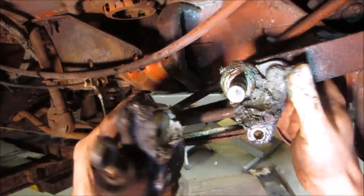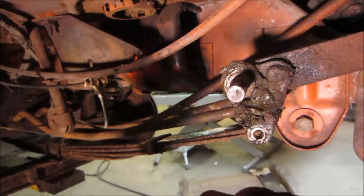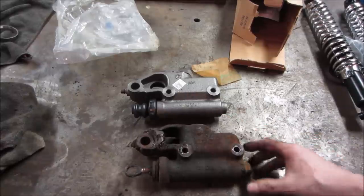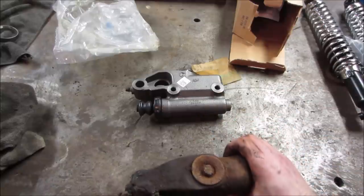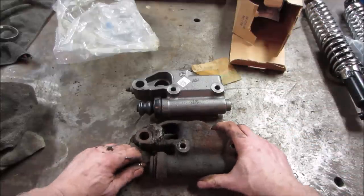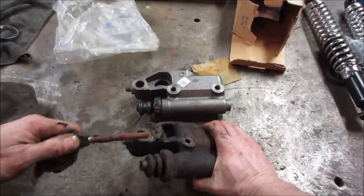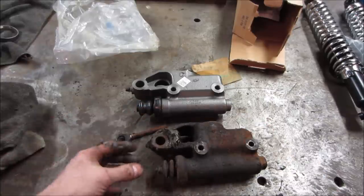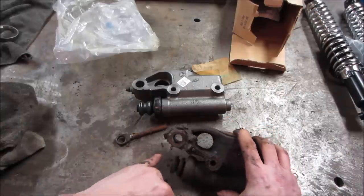We're in. Bushing to transfer over. So clean that up. What a bench we got. And it looks the same, huh? Just got a plastic reservoir cap instead of whatever is on that one. So we need the rod. Yeah. Good thing we're replacing that. I'll clean that up on the wire wheel. And then we got to get the bushings out of this. Put it in a vise so you can take a punch and knock them out.